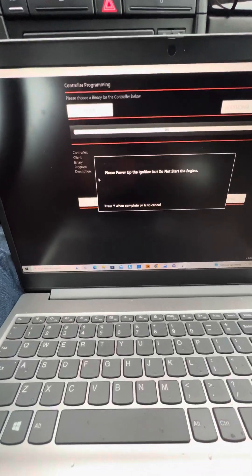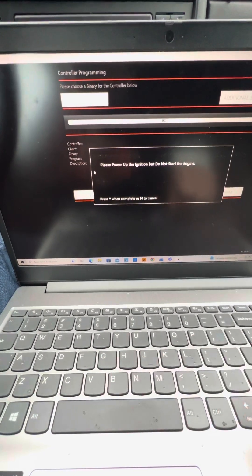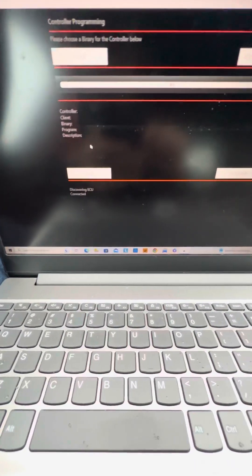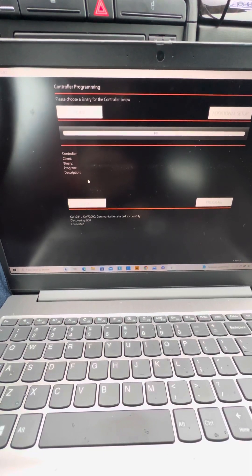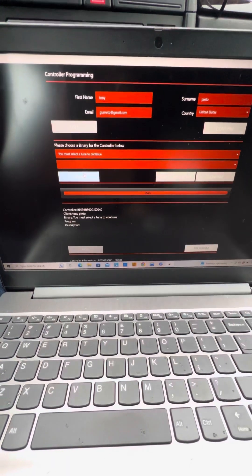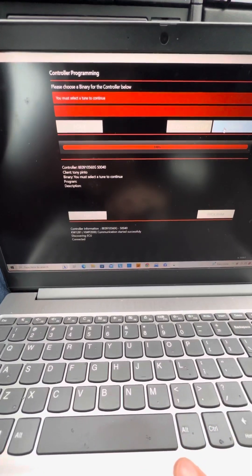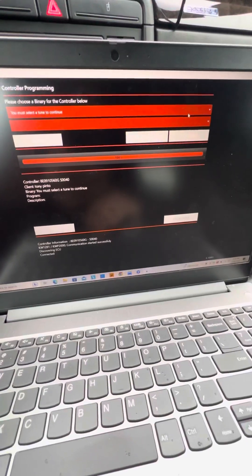All we're going to do here is go to Program Engine. This is going to recognize the ECU code that your vehicle has and will show you available flashes for that vehicle. We're going to hit Yes because our key is forward — bear with me in the video because some of these buttons don't really show the contrast very well. It will just take a second. For dealers, there will be a spot to enter a customer. It will show you your ECU ID code down here, and that is what you will select in the first box.